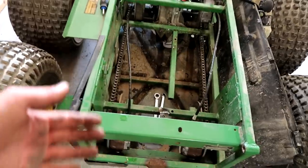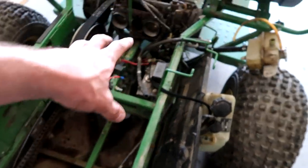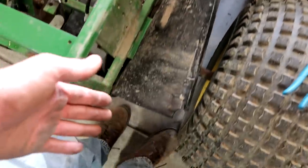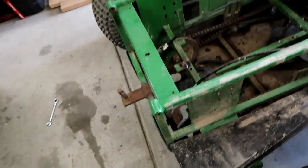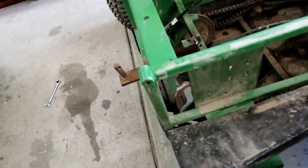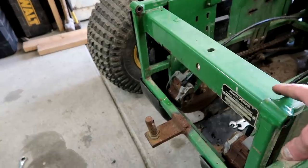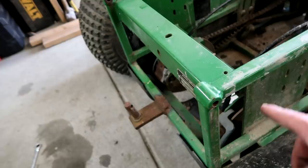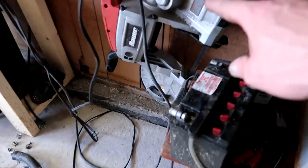This thing's pretty well gutted - the gas tanks are out, batteries out, battery mounting bracket is out, some of the computer stuff is off the frame. This piece of plastic is bungee corded around the axle there and pulled down so I can saw this back portion off. Since it's got this nice little piece of angle iron here for strength, I'm going to utilize that - I'll cut here and here. We also got our oil reservoir off and our coolant reservoir off.